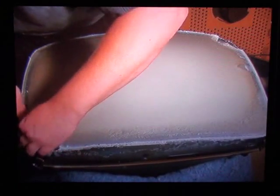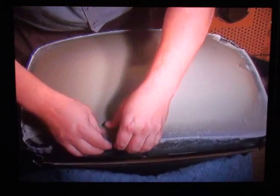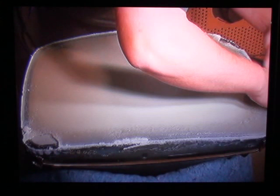Let me just point out that there's a little bit of difficulty encountered here. The PVA material theoretically should come off in a sheet. Even though we got the lens nice and hot, for some reason there was a little difficulty — it came off more in pieces. It's not the end of the world; it's still easy to get off, but you've got to use a razor blade. Just a flat razor blade knife will go underneath the PVA and lift it right up. It works quite well.